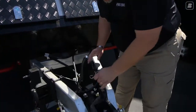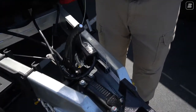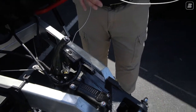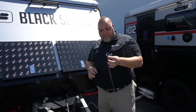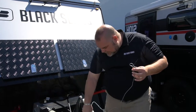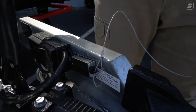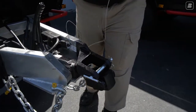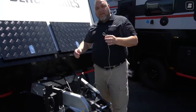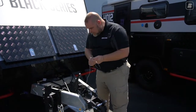Another cable down here is our emergency brake. You connect this cable to your receiver on your vehicle, separately from your chain — don't attach this to the chain. The idea is that this key pulls out, and the battery power will set the brakes. So if something happens and the trailer breaks loose and the chains fail, this will pull and stop the brakes on the trailer to keep it from rolling. That's our emergency brake.